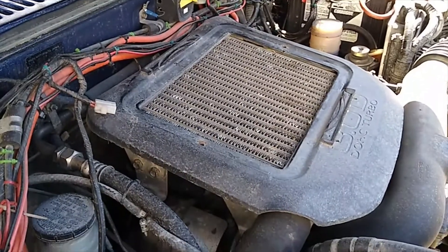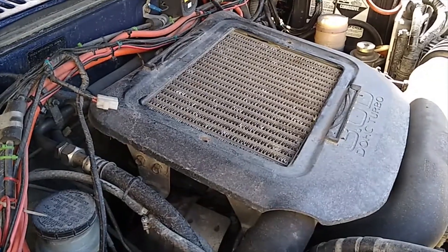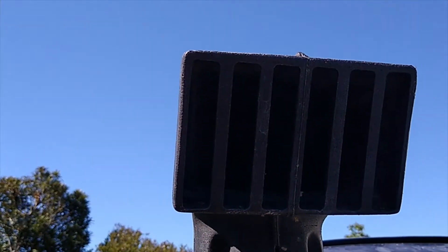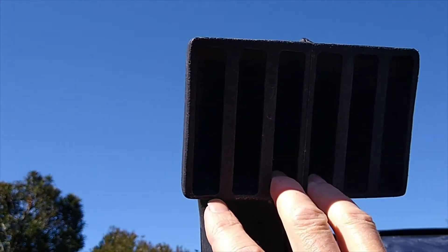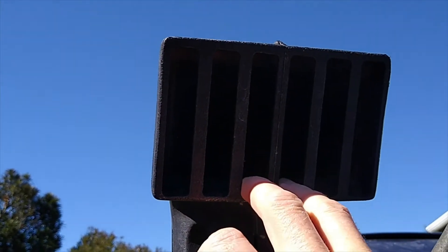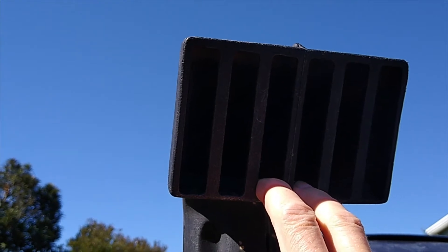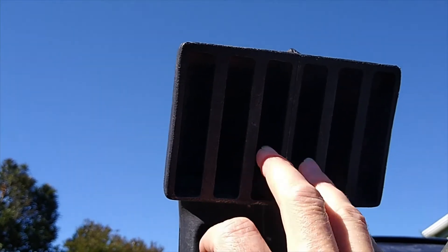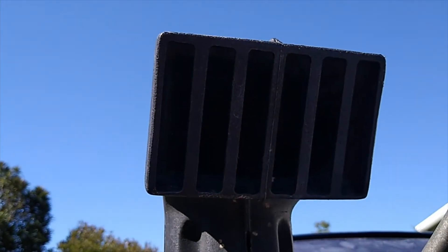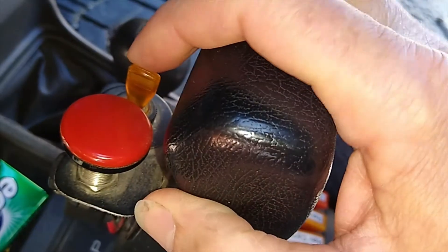One other thing I've noticed is that at idle it's also a lot more noisy through the intake manifold on the snorkel up here, because without the throttle plate butterfly partially shutting, there's nothing suppressing the noise bouncing back through there. Also, looking at the gear lever here, there's a switch which turns on the exhaust brake.